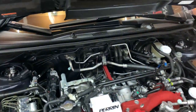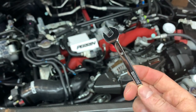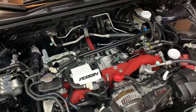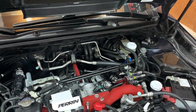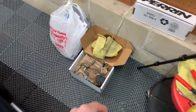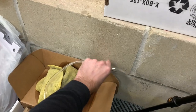But first, before we get her, let's hook everything up and I'm going to show you exactly how to do it. So the tools that you will need are an eight millimeter wrench. You're going to use this end — you can use the open end side, but it's a little bit more difficult because it's going to fall off the bleeder valve. So using this end here is going to be much easier because it'll actually stay on the actual valve. The only other tool that you're going to need is some type of tubing. You can do this just letting it shoot into the engine bay if you wanted to, but I don't suggest it because it's going to get everywhere and brake fluid, hydraulic fluid, will eat through anything. So I suggest getting something like this — all it is is a clear tube, and you're going to hook that to the end of the bleeder valve and it's going to go into a container.